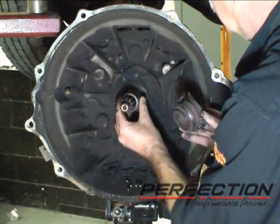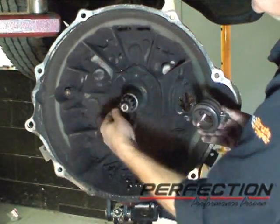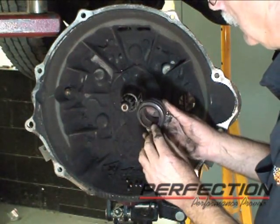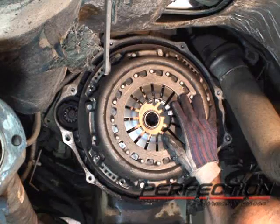And the front of the transmission here is dry, and actually this is the most wear I've ever felt on an NV5600 transmission. Also the highest mileage, but the most wear. So we got a little work to do to clean that up, and I believe this bearing was installed incorrectly without being greased at the time of installation.